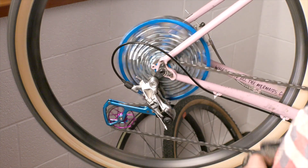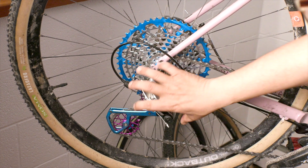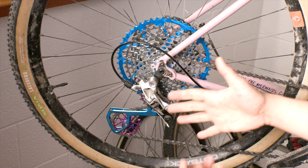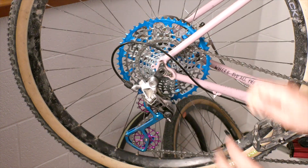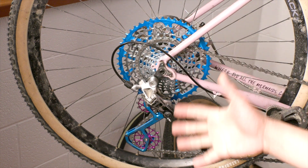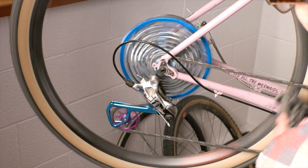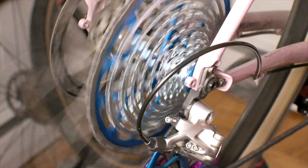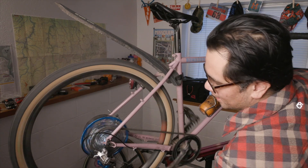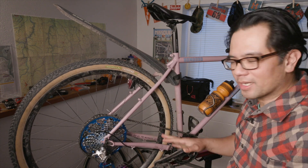In my opinion, this shifts amazingly well. The basic concept is that it still maintains the road cable pull because it is using the upper part of the derailleur, but it just gains the range of a mountain bike because of the longer cage and pulley wheels. Going up and down the cassette is pretty flawless. Compared to when I used the Wolf Tooth and the Sunrace cassette, this is much smoother. No problem getting up to the big gear, no problem dropping down — one shift, one click. The quality of the shifts is really nice, crisp, and precise, as if this were just a regular-size road cassette. Really transparent, nothing funky, doesn't grind — way smoother than the Sunrace cassette. This thing just works.